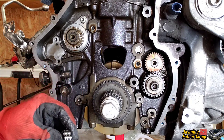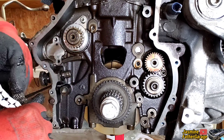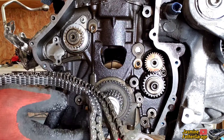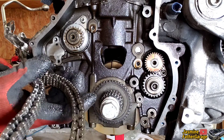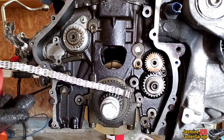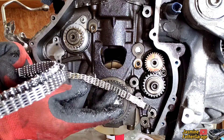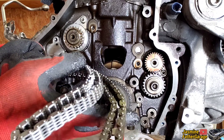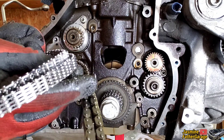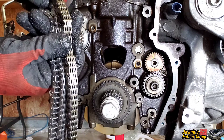Here's the new chain — the darker one is the old one, the lighter color is brand new. If you bind them up and tilt them on the side, you can tell the old one sags down because it's stretched. The new one sits higher and doesn't sag. That's how you can tell a chain is stretched. The length difference is hard to measure by eye, but the sag makes it obvious.